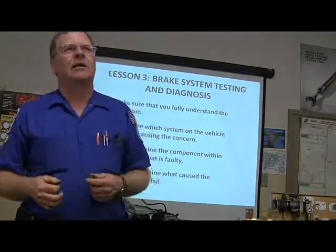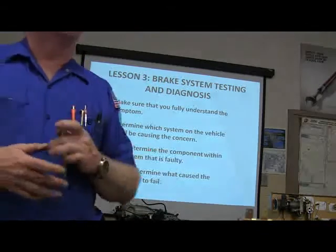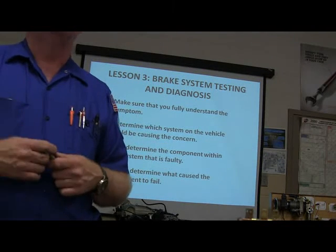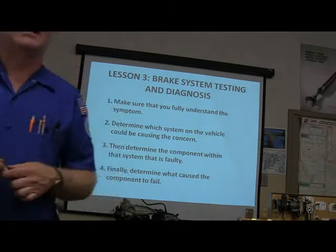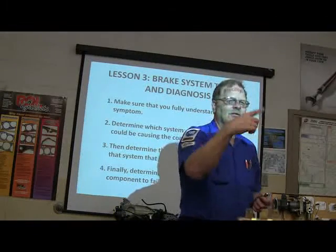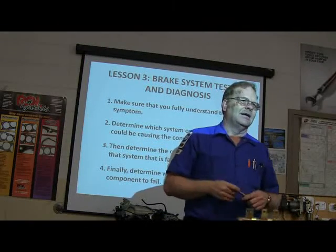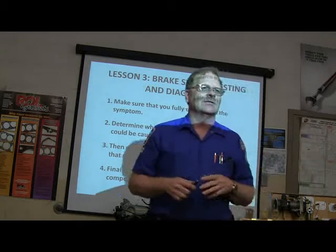And you can sometimes tell if the engine, well, like the other day, Melissa was pretty sharp, way out here listening to this ticking noise on this Jeep. And I said, well, it's a strange ticking noise. I said, well, let's pull the belt off and see if the noise goes away. See, we're trying to determine if it's in the front end accessory drive, which is where your belt and pulleys are, or if it's actually somewhere else. So we pulled it off. When you first started it, it wouldn't make the noise, but it would start making it. And it started making the noise with the belt off. So what did that tell you? It means it's not in the front end accessory drive.